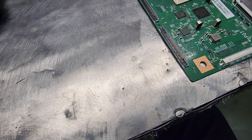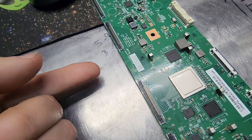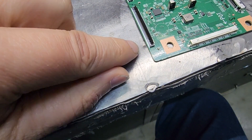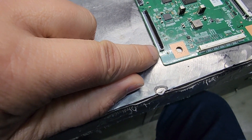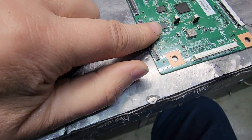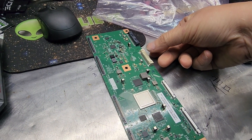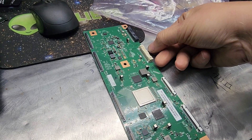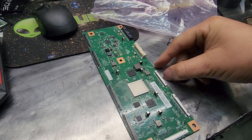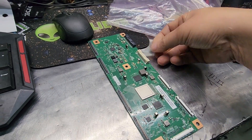If you pull the cable without unlatching, you're going to damage that strip connector and it'll be ruined. Lift up to unlatch. When you pull the strip back in, it should have a black line on it — line that up with the white connector, then close it up. For these connectors over here, you just push down on the plastic and pull out — you squish in and pull out. And for these two over here, it's a plastic tab — you just press and pull out.